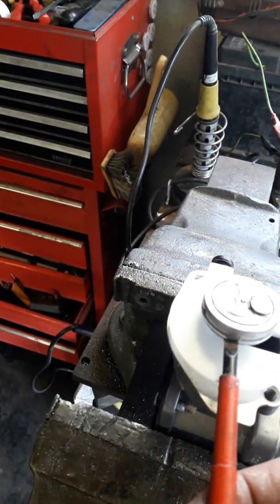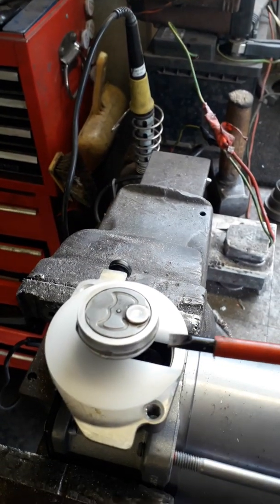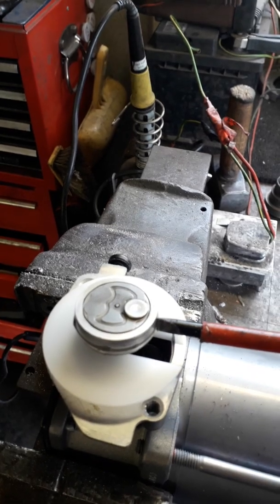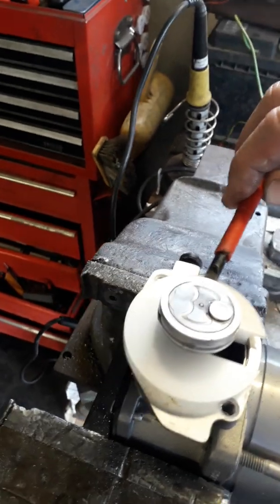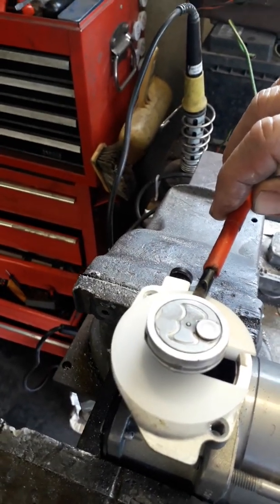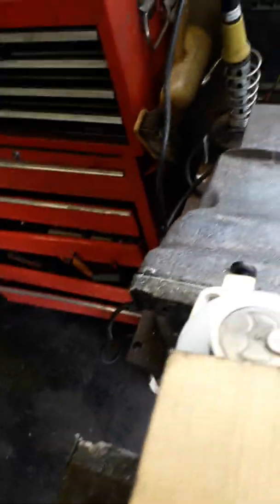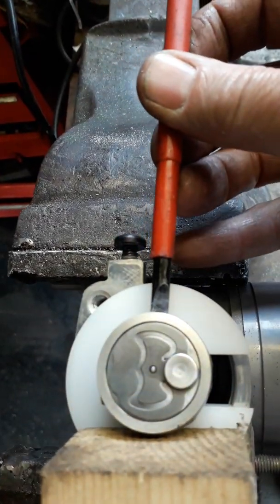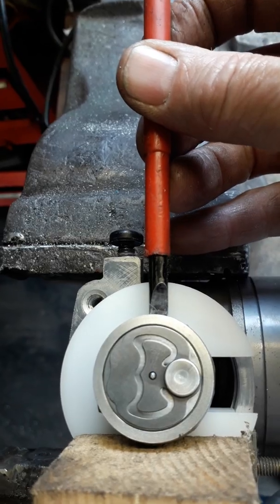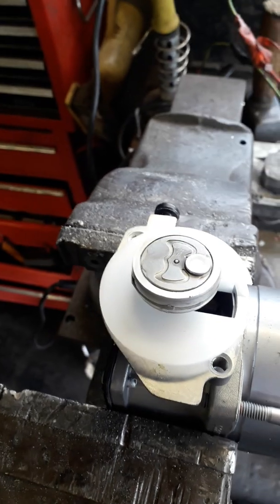You have to be careful not to snap the underneath side off, and never apply pressure in this direction because the piston head is pretty fragile. So if you are driving a wedge in this direction, make sure you support the opposite side of the piston if possible, and this will help you to avoid snapping the complete piston head off.